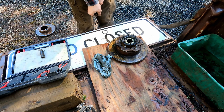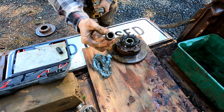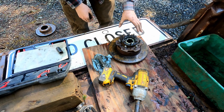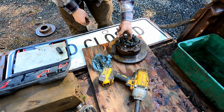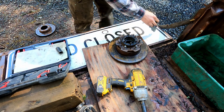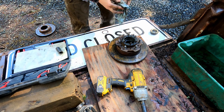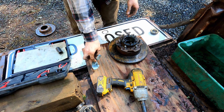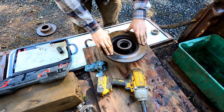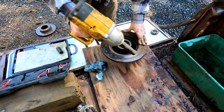Switch from the 21 to a 14 — preferably a six-point socket, though a 12-point will work. I set the hub assembly down so the bearing will pop out in a controlled direction, then place the bearing on a nice clean surface, touching it as little as possible. Then flip it over — at this point we have to separate the hub from the rotor. There are six bolts on the back side, which is what that 14 millimeter comes in handy for.